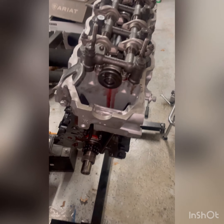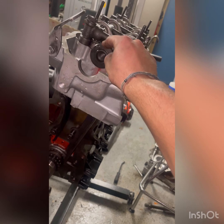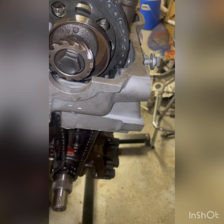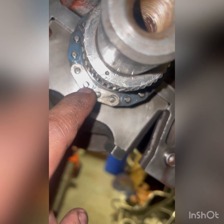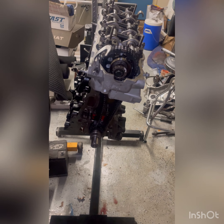Now for the rest of the timing - I'm completely lost. I know that this goes right here and I probably need to spin this to be straight up, and I should have done that when I was putting it all together. The chain goes from here to here. I did get all the timing put together - I have the light notch right here, you can see the little circle, that's where that one goes. I put all this together for the distributor, and then the chain goes all the way down, got all the guides in. There's a little dot right there - these go right in the center - and then I've got the tensioner on. Timing-wise it's ready to go, time to put the timing cover on.